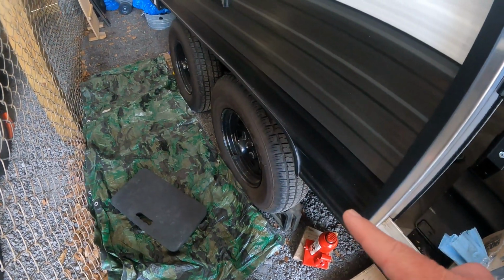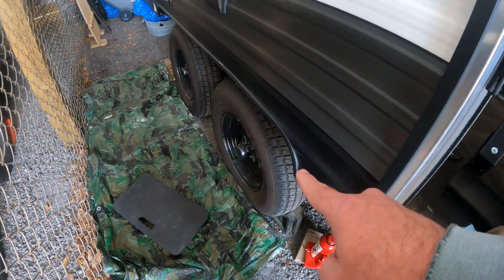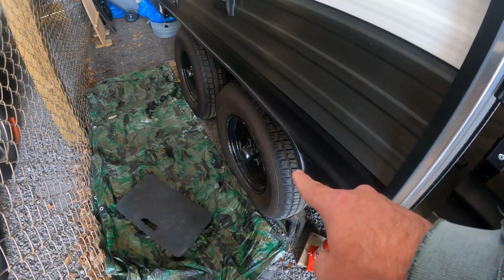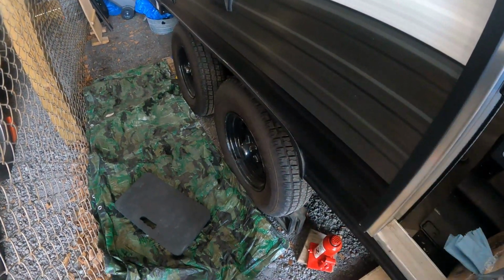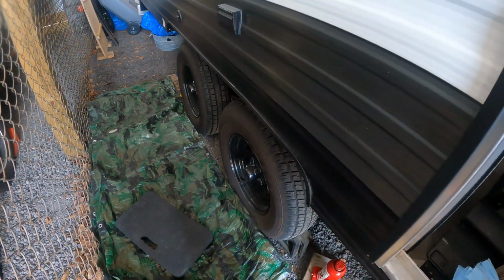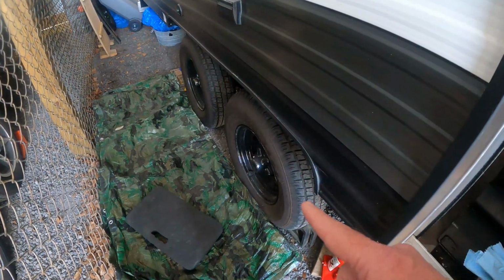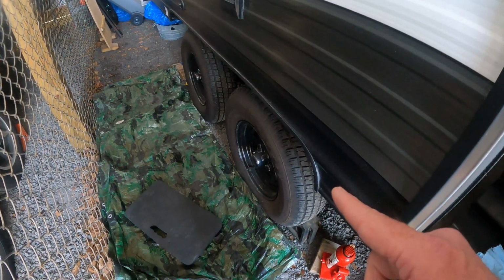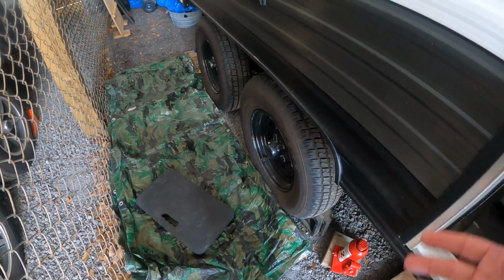The other thing that's happening, if you're putting like 3 or 4 pumps per trip in this and you're seasonal, you're filling that thing up, and that axle seal, that bearing seal, will blow on you because it's too full of grease. So, do what you want to, but I'm telling you, if you're seasonal like we are and you don't put a lot of miles on this thing a year, there's no reason to pull and repack every single year, unless you just got nothing better to do, or you want to, or peace of mind, or whatever.